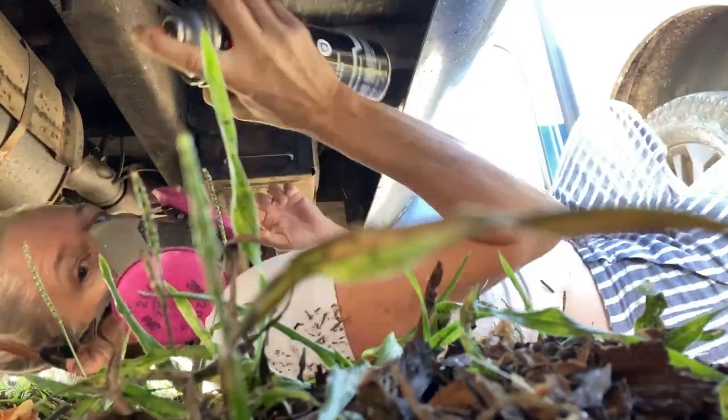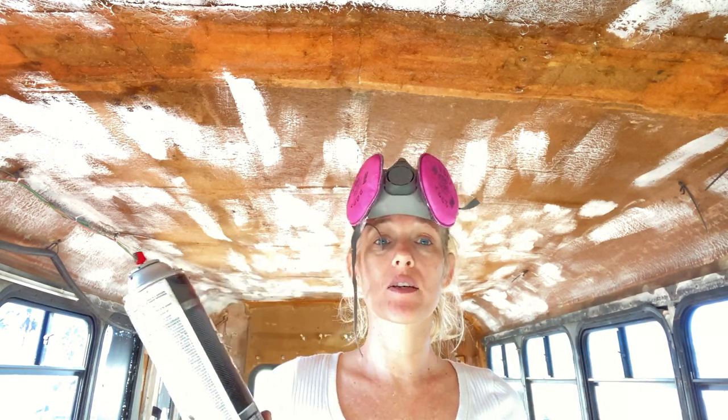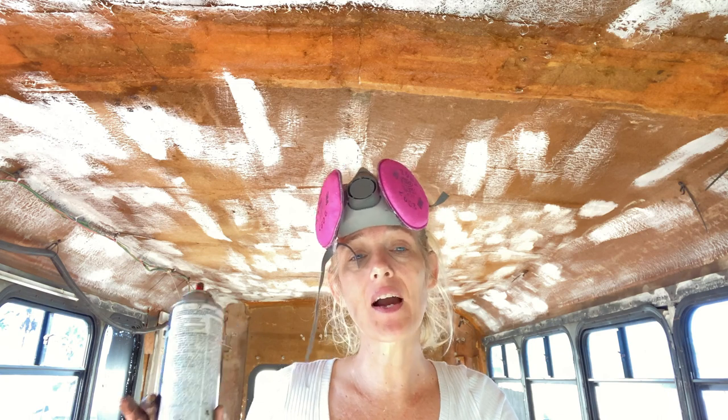See, this is all the bottom of the wall inside there. I'm going to spray all of that with this stuff and hopefully that will protect it. I already did that side over there. There were quite a few exposed areas underneath there, so I'm really glad I got under there. I went around the whole bus and sprayed all along the edges and used the whole can. I feel a lot better — it is now 95 to 99% waterproof and sealed from underneath.